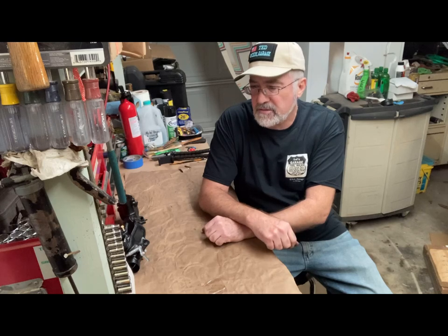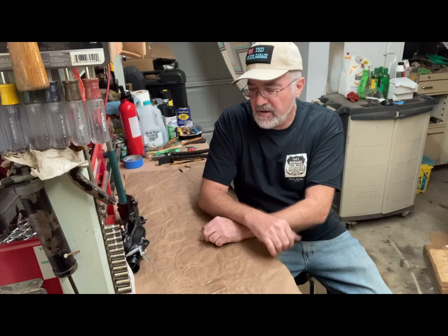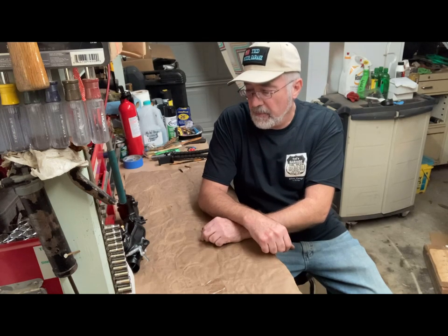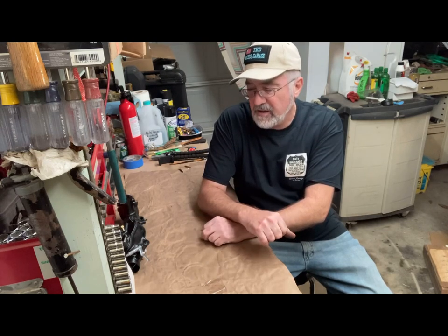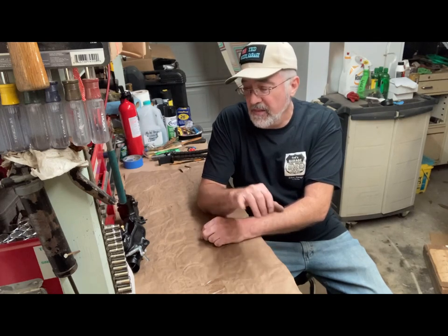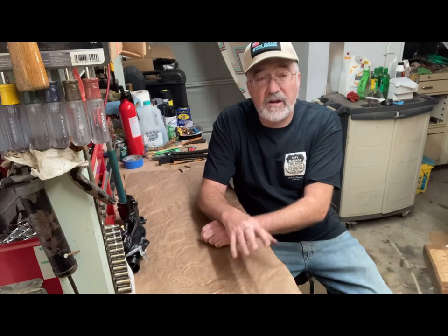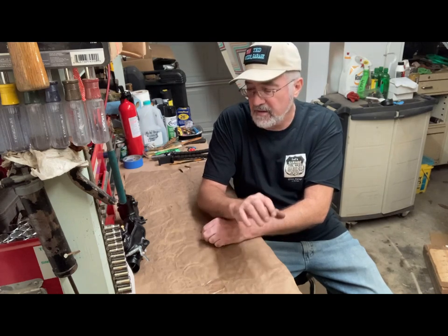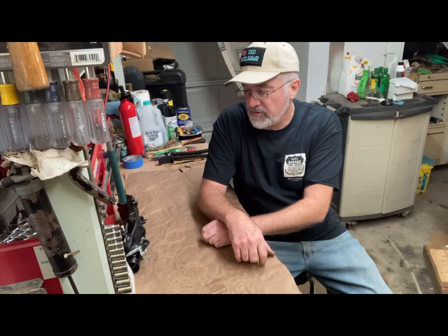I went up there a couple weekends ago and we were just having backfiring and lots of problems. We got it running, but not very good. So we'll try swapping carburetors. He's got a Zenith on his 28 coupe, and we know that's a good running one. Then I might take this and try to test run it on the 28 coupe, because we know the ignition and everything else is working fine on it, and not introduce new problems.